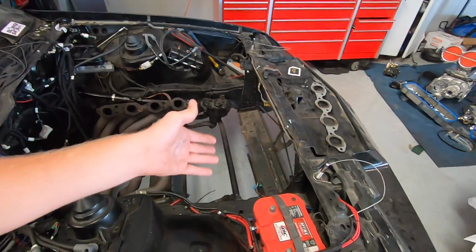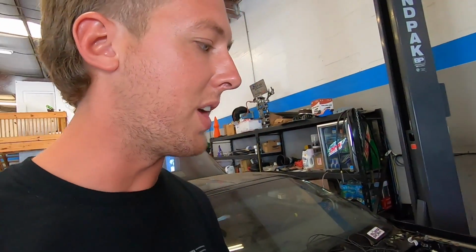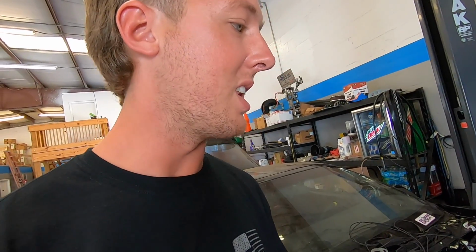Well, turns out it is a massive pain in the butt to put a giant radiator in a vehicle like Toast. So we were just like, oh, we'll put this little one in, see how it goes. How'd that go, James? Not well. Believe it or not, when a 632 with a 1071 blower on it idles, it can literally overheat with a stock size radiator. Now, we have a pretty decent radiator. We have some pretty decent fans on it, but it's just not enough for this thing.